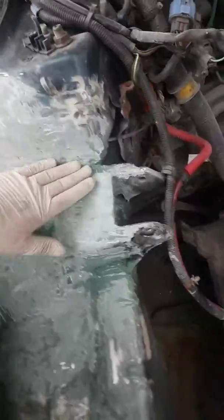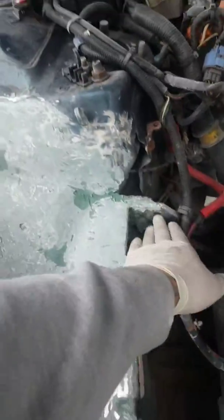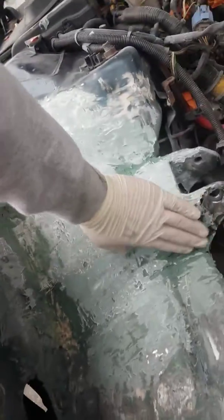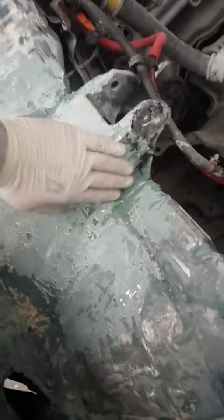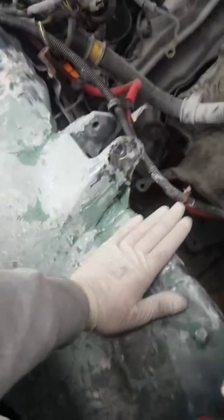Now that the spring's coming around, I have more time to work on it. Weather's nicer, so I welded in all kinds of panels and then fiberglassed them. I welded in a little sheet right here to cover this up, and then it'll be flush with the Hasport motor mount right here. I filled this in with a little piece, tacked that in, and then I got to fiberglass over this, flush it all out, make it nice and smooth, and round it off.